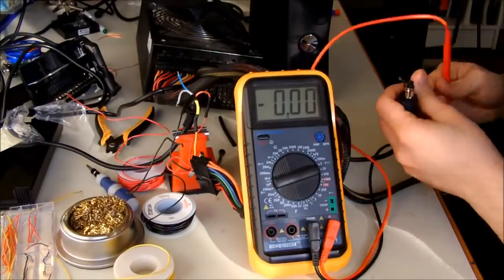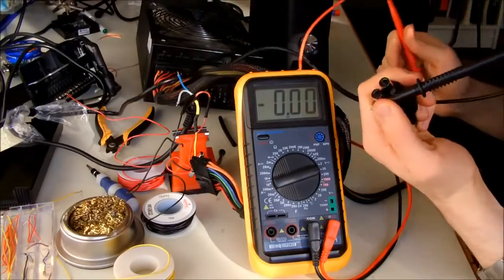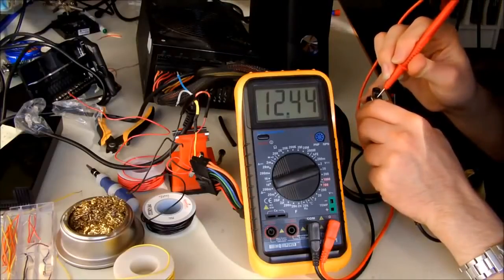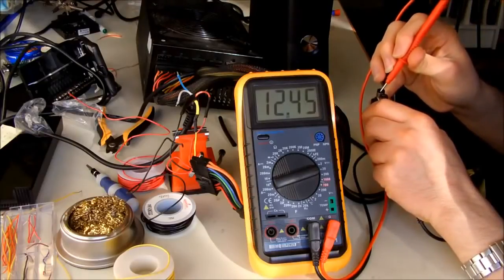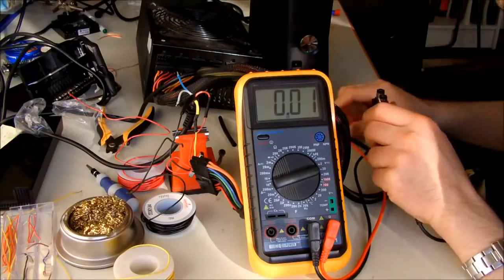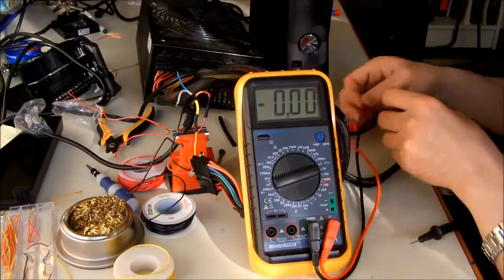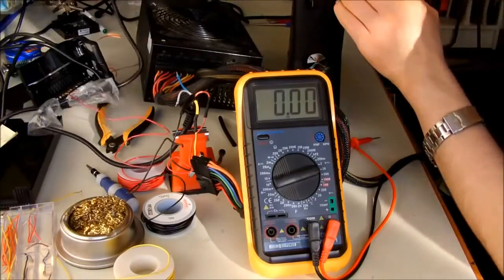And just to prove to you that the wiring was okay, I'm just going to probe the end of the Xbox cable with my multimeter and see if we have 12 volt and 5 volt there. As you can see, this is our 12 volt, and this is our other 12 volt. Then we have 5 volt, and everything is okay. So we are giving the Xbox sufficient power, and it's not getting turned on. Yeah, going to just connect it again and try again, but I don't know.